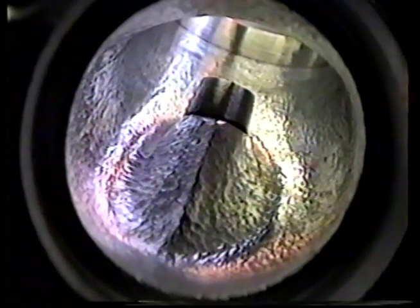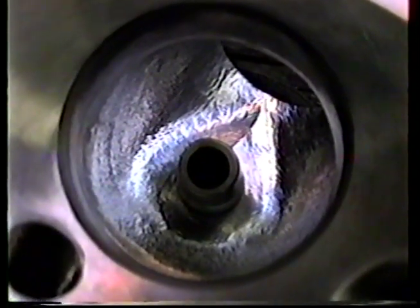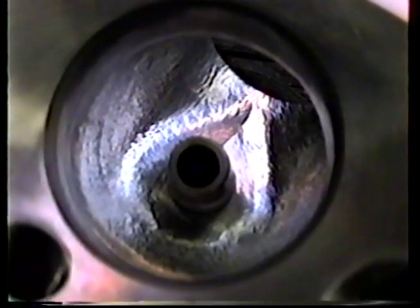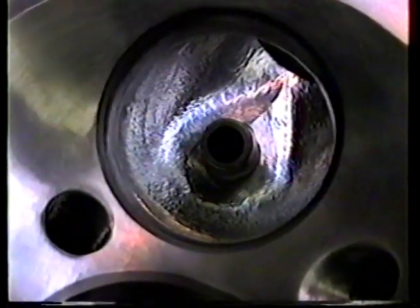We're going to let you come on through and take a look all the way through these things. I'll try to take you through with this pointer. You're looking at the intake port from the combustion chamber side. You can see this nice tool finish we use to atomize the incoming fuel. We make the finish a little finer up here — we polish the seat pocket from the pointer on up, and this is where we start our taper, right up in here, and we just roll it right around the seat. It's our own special method of doing it.